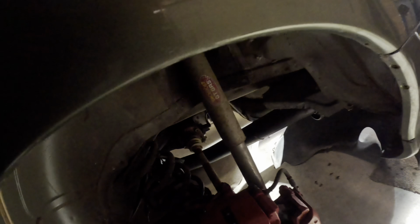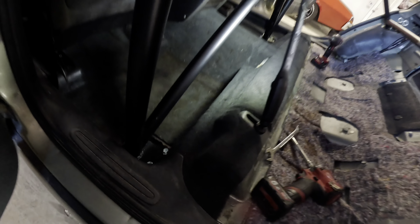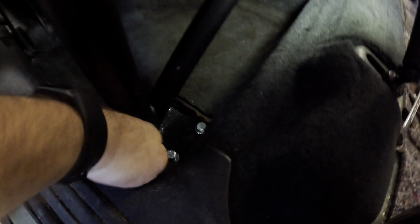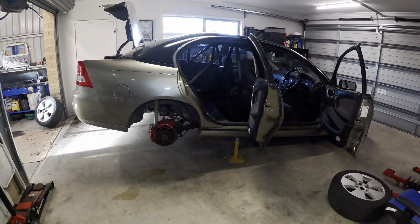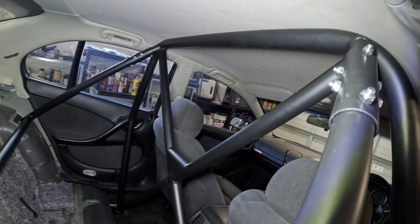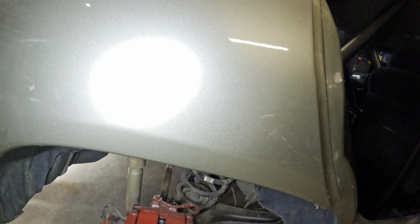The cage is back in, sitting down in the clearances we made with a bit more headroom to the headlining now that it's sitting lower. We'll start by drilling the holes for the wheel arch mounts, get those bolts in loose, then do the bottom floor mounts as well. All the sleeve bolts are just sitting loosely. One little trick — I couldn't drill one hole from the inside, so I did the other two first, put the plate on, then drilled that one from underneath. We'll just keep going and show you the final result when it's all done.